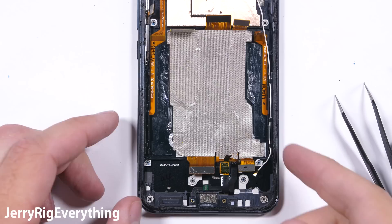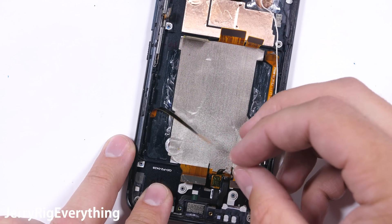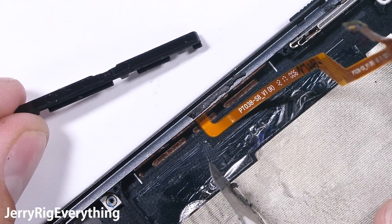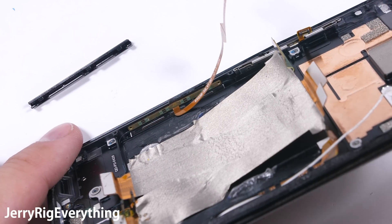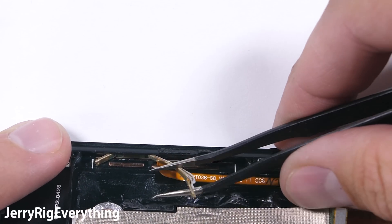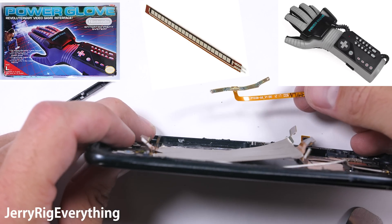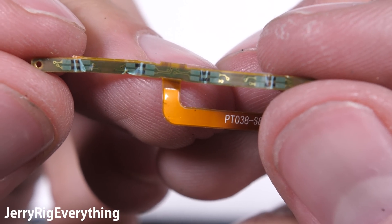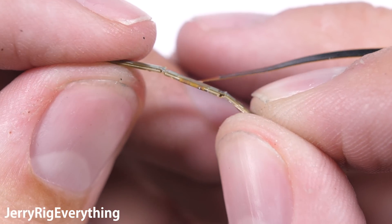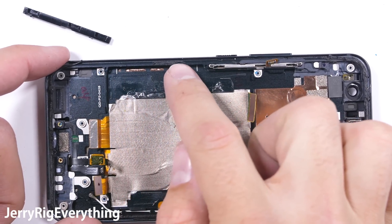Now for the part that is completely unique to this phone — there is no other phone manufacturer that has ever attempted this before. Squeezable sensors built into the aluminum frame. The theory is that the metal sides of the phone can be squeezed or flexed, and it can act as a trigger or button for different apps or features inside the phone, like the camera. It's not capacitive because HTC says it can be used with gloves. After lifting that ribbon cable, there is a plastic bracket with grooves that run the signal wires. This comes off easy enough, and we get our first glimpse of the actual pressure sensor — it has 4 individual joints and is extremely well adhered to the frame. I don't imagine this can be removed without damaging it permanently. Flexible pressure sensors aren't a new thing; it's the same type of technology used inside the old Nintendo Power Glove back in the day. HTC is the first company to stick it inside a phone, though, underneath metal. I assume that as the metal sides flex when the device is squeezed, the resistance changes along each of the joints, telling the phone that the grip has been triggered. With a more rigid frame, this feature probably wouldn't work. Huge thumbs up to HTC for trying something new and stepping out of the same rectangular box that most other cell phones are stuck in. The ideal, most sensitive squeeze points would be on the lower half of the phone, right where the sensors are located.